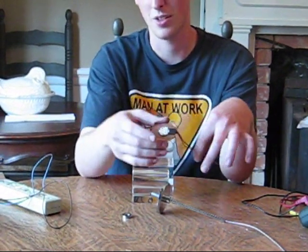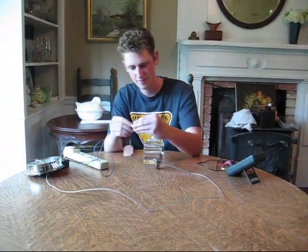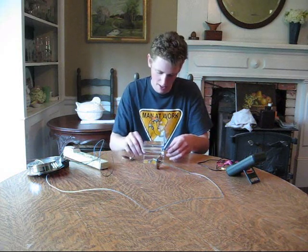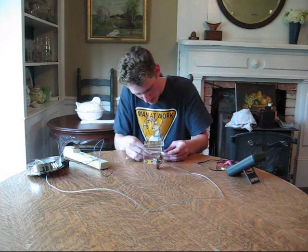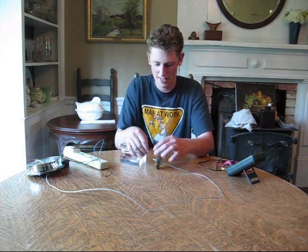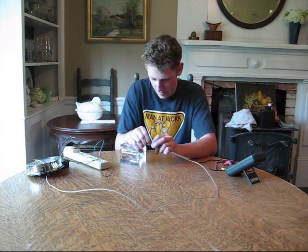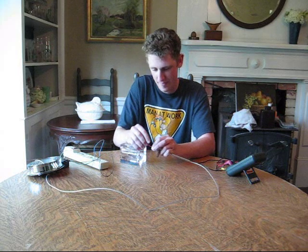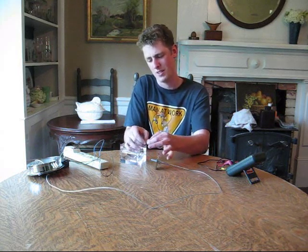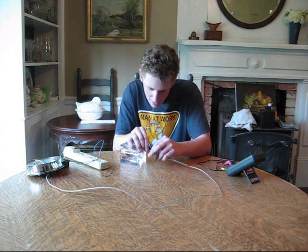This particular fixture can be a little tricky, but we'll get it in nonetheless. First I'm going to throw the wires through here. Next I'm going to plug it into the socket, and I've already marked it out for polarity reasons. I've actually soldered the ends of the wire so it's rather stiff and will go into the original halogen bulb socket quite cleanly.